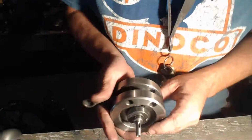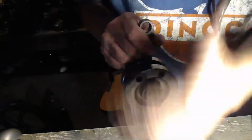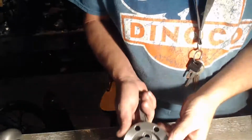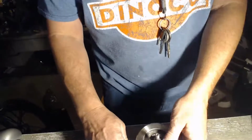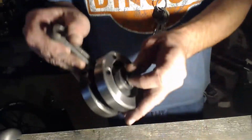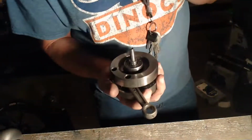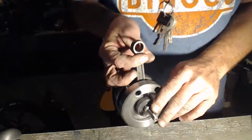I'm dyslexic, so I'm backwards a lot of the times. But there'd be a way to set timing with a clock face, and then this being the number 1. And you could always find 0 because it's 1 o'clock. Because I know on this crank it's 1 o'clock, and on the rat crank it's 4 o'clock. And that could be set without setting dead stop, without setting anything, just knowing that the Woodruff key is 1 o'clock. But yeah, that's what I've been thinking of, as a way to set timing with a clock, an analog clock wheel, and using the arm as the Woodruff key at 1 o'clock or 4 o'clock, depending on where it's set.